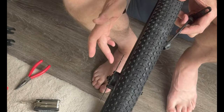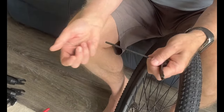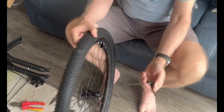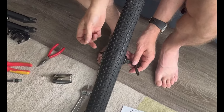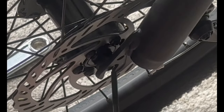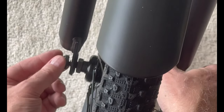Line up the disc with the disc pads correctly as it goes in. Remove the bolt from the side and remove the spring, which gives you enough room to pass through the actual wheel and get the forks in. Then fit the spring and the bolt on the other side. There's a hole right the way through the front wheel - push the bolt and it comes out the other side. With the smallest bit towards the frame, just offer that up and it will screw on.